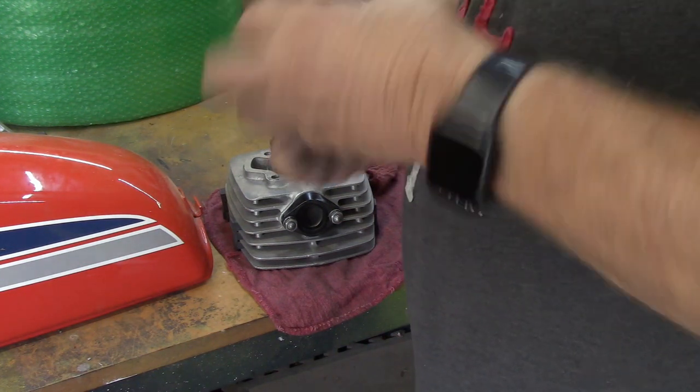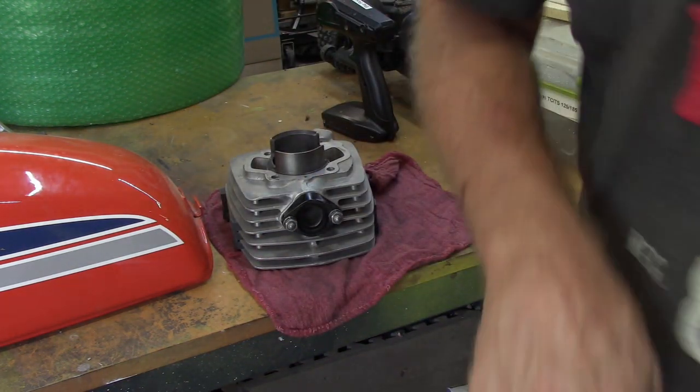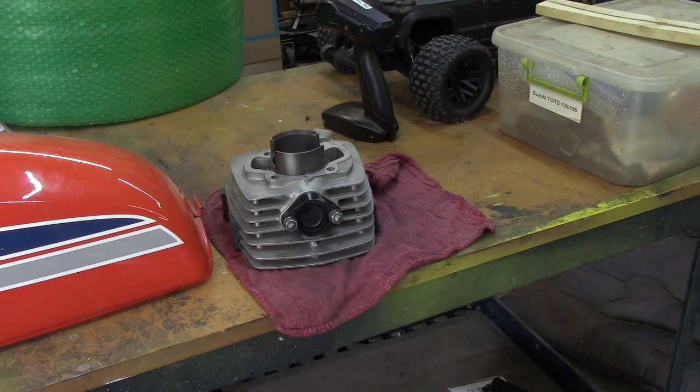Let's see, I can get it started, and then you can't get it back out. So, I can order another wrist pin. But, man, the wrist pin is not going to be causing this problem with the low compression. It can cause other problems, but not that problem.